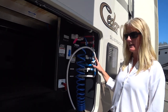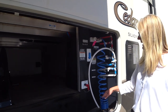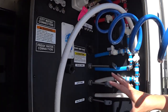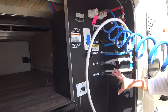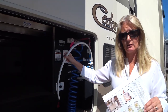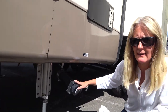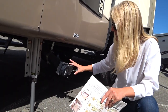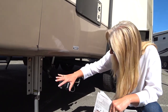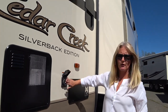The service bay is inside storage where you hook up your hose to drain the black tanks; it has a water hose, taps, and all the valves. What we like is that everything is inside in a heated area of the trailer, so things won't get as dirty or risk freezing. There's also an extra connection for winterizing, which is handy. The main drain where you hook your hose is outside near the jack — we'd rather it be insulated, but that's not unusual.